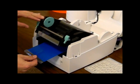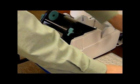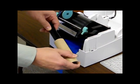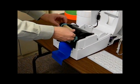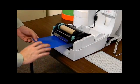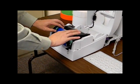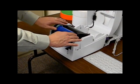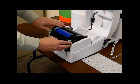Pull the ribbon forward about a half a foot so that the ribbon is extracted beyond the printer. Take the other cardboard core and slide the second black core holder into the core and place it on top of the ribbon and print head assembly. Affix the end of the ribbon onto the cardboard core and rotate to take up some of the ribbon. Press the ribbon assembly down until the assembly clicks on both sides.